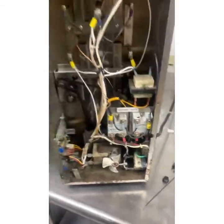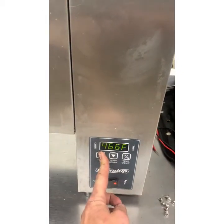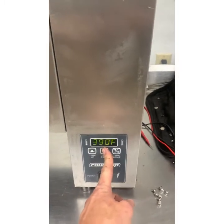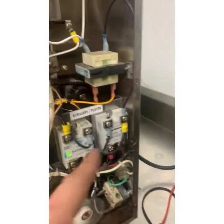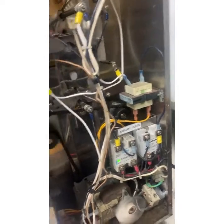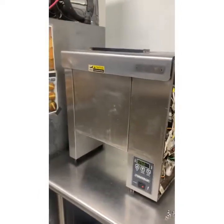Ready to fire it up — and there you have it. Plate is at 466°F, set for 460°F. Air temperature is at 390°F. The plate temperature probe cycled off — the thermostat is doing its job, starting at 460°F. No high limit issues. Toaster revived.